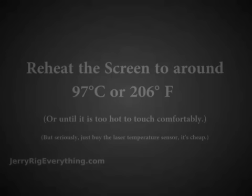And a couple things to be aware of: if you overheat your phone, you're going to discolor the LCD. Also, when you're pulling away the glass shards from the body of the phone, if you pull up one edge of the shard while the other shard is still adhered to the LCD, it's going to put a lot of pressure on the LCD and could possibly crack it. So you have to be super careful with that.